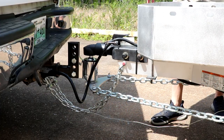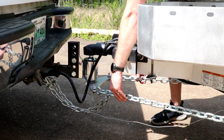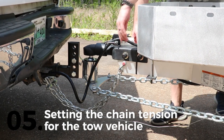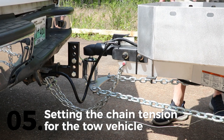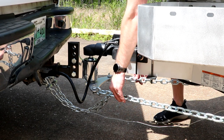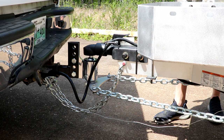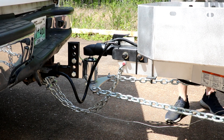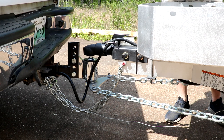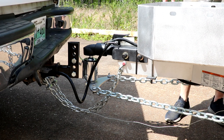Let's take a look at the Anderson chains. Now that we've lowered the camper back onto the tow vehicle you'll see some tension. The more tension you have, the more weight distribution it applies across the tow vehicle. Each chain also works against the other to provide the anti-sway feature. Let's look at how to tighten these chains if you want to apply a little bit more weight distribution.